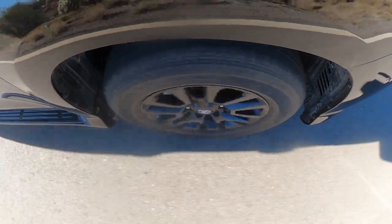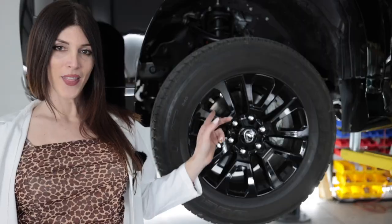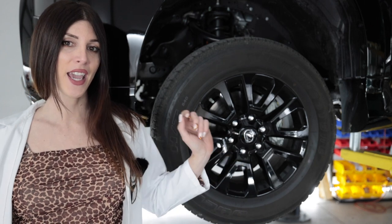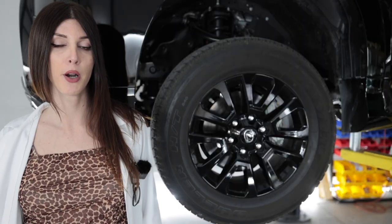It's time for the braking test. No one behind me? Ready? That was loud — that was all tire screeching. Pretty good, gets the job done. Nose-dives hard. That braking was accomplished with a set of 13.3-inch front rotors and a four-pot caliper, which looks familiar to the one found on a Tacoma — may or may not be the same part. Toyota likes to parts-bin things.